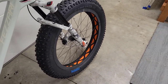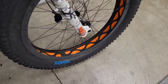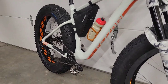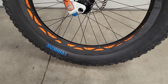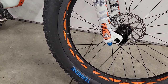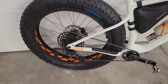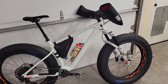Got it off the stand and the wheel mounted — the herkiest jerkiest YouTube video of somebody putting fatty strippers on their bike. I think they look really cool: orange and white, kind of a creamsicle look. I call this bike 'the Wampa' after the Star Wars cave creature. I'll trim off the excess once the air settles, then go out for a few rides, try some crazy low tire pressure — like 2 to 3 psi — and report back on whether I've eliminated any leakage around the bead and achieved burp-free riding.